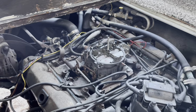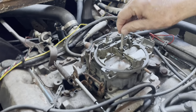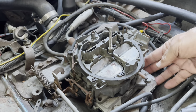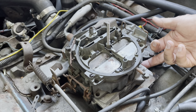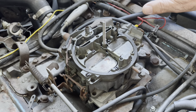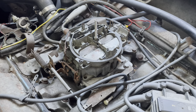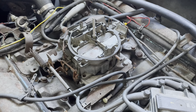Here's the carburetor. Whenever you go to your carburetor, check these four bolts right here and snug them. The reason is that there's a thermal gasket under here — it's real thick — and when you tighten the bolts down the gasket compresses and the bolts feel like they backed out, but they didn't. The gasket compressed. So every time you lift the engine cover, snug those four bolts — not tight, just redneck snug.